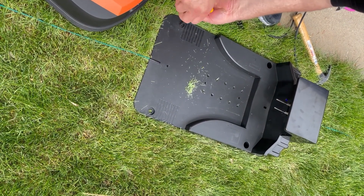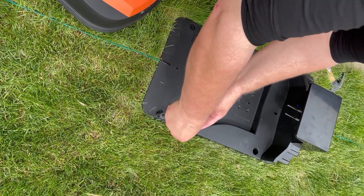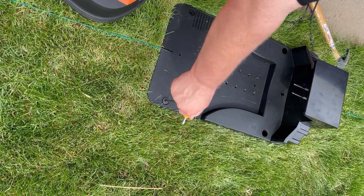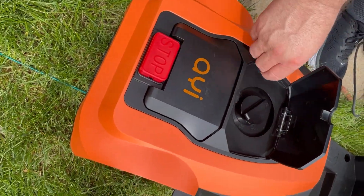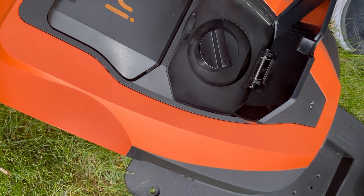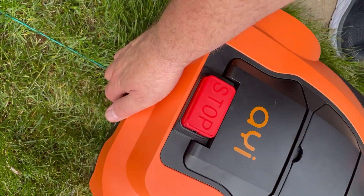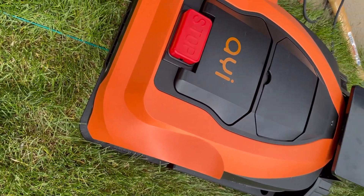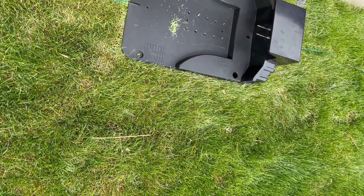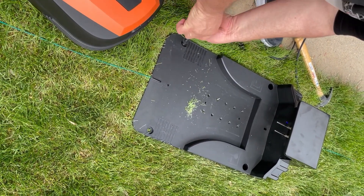Once your perimeter is set, grab the Allen wrench and use the ground screws to secure your charging station, creating a flat strong surface for the robot mower to park and charge. Then set your cut height — there's a lid above the LCD display hatch you can pop open. The dial is metric; it moves the cutting height shorter or longer, from about 1 inch to about 3 inches. I have mine set at 3 inches. Despite this mower being 17 pounds versus a push mower at 100 pounds, the 3-inch robot cut feels equivalent to my push mower's 4-inch cut height.